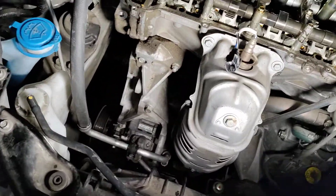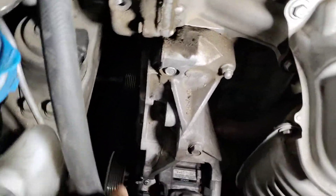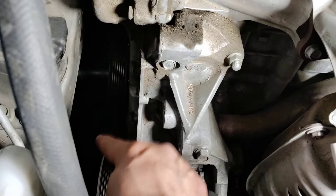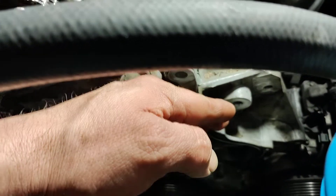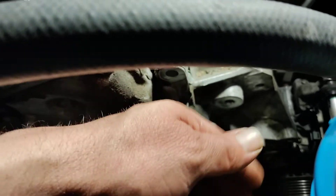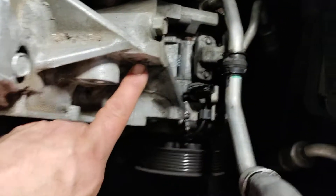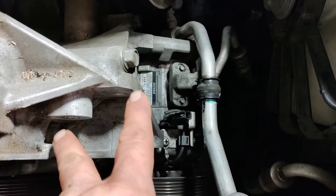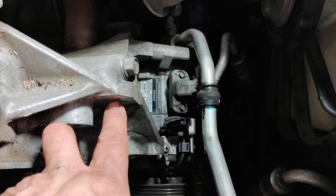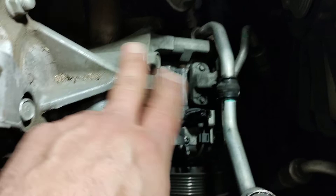Now if you're doing the timing job on this, you're also going to get into a situation where you need to remove the alternator and the belt tensioner and all that on this side — it is a real funky setup. You do need to remove the belt tensioner completely to get that out of the way in order to get down here to this bolt — it'll be a hidden bolt. This is what mounts your alternator, so belt tensioner completely out in order to get the alternator completely out of the way.